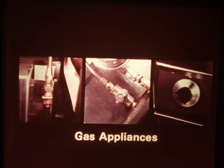Turn off all the gas appliances. Set the furnace manual valve and thermostat at off, range burner pilot off, oven at pilot off, and if the motorhome is equipped with a gas refrigerator, the refrigerator at gas off.